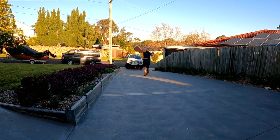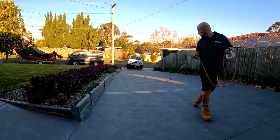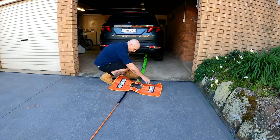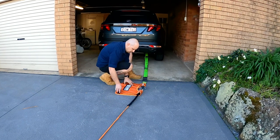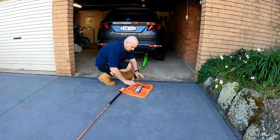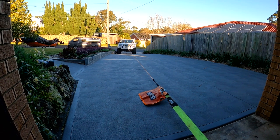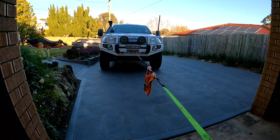When spooling back in, use some sort of tension as you wind the rope back in. The easiest way is to connect to a solid anchor point and winch slightly uphill, using the weight of the vehicle as the tension. A word of warning: be smart about what you anchor your winch to. Yes, you're not bogged, but you're still putting a lot of tension on the winch, so you need a proper strong recovery point — and of course, use safety gear too. This also gives you an opportunity to inspect the rope for damage, and as long as you're winching in a straight line, will ensure the rope is neat and can be unspooled easily the next time you use it.